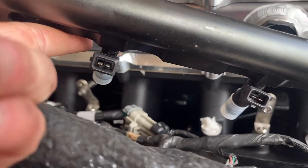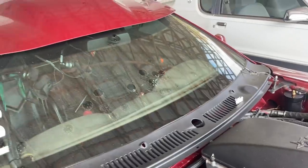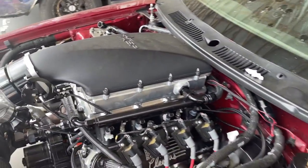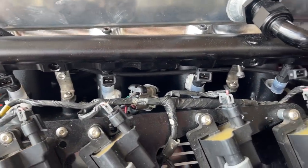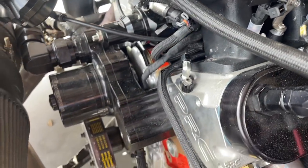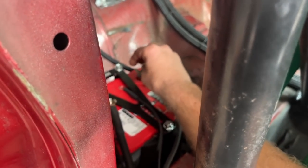I've got each one of the injectors back on the rail, and I've left the caps on them. What I'm going to do is turn the Terminator on and see how much these things fill up with fuel, or if one or two of them are continuously injecting fuel — because I do not want fuel accumulating in these heads.